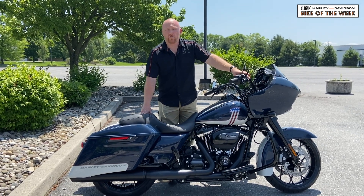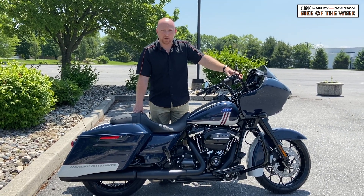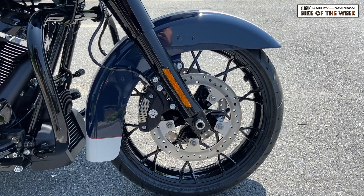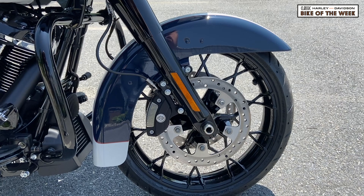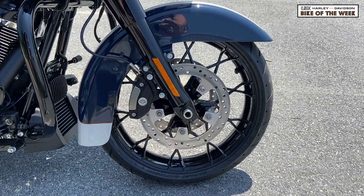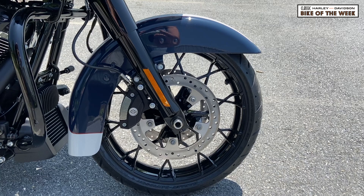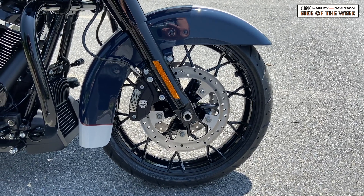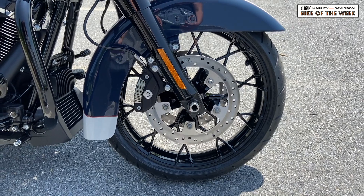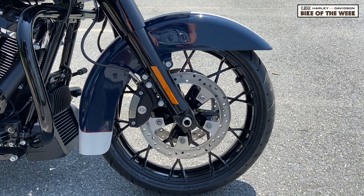In 2020, with RDRS, we've released a True Traction Control. The True Traction Control does quite a few different things than just pulsating the brakes if it notices a slipping wheel. This bike has what's called an IMU, or Inertia Measurement Unit. Basically, as you're going down the road and lean into a corner, it knows how much lean angle you have, it knows how fast you're going, and it can sense whether or not you have any sideways drift. If you have sideways drift while you're on the brakes, it can pulsate the brakes while you're in a corner based on the sideways drift — not just the difference in speeds between the front and rear wheels. That's called corner-enhanced ABS.